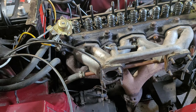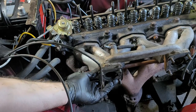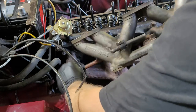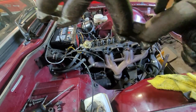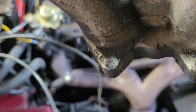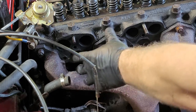Should have taken the hoses off first. This clutch cable is going to keep getting in my way as usual. I plan on dealing with the electronic choke so I can move that altogether. There's our inlet manifold - if you can see here hopefully with the light - let me zoom in. You can see the little divots where the clamp goes into - there's one there and then the other one is on the exhaust manifold. The little piece sits in the groove and crosses up the studs in the middle, pushing the two of them together.